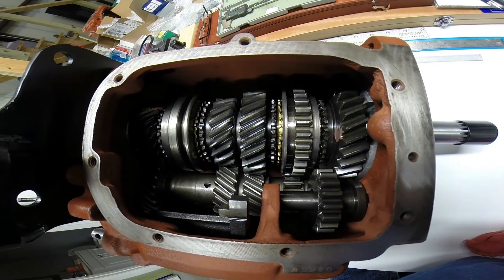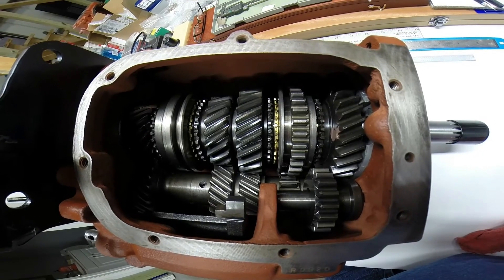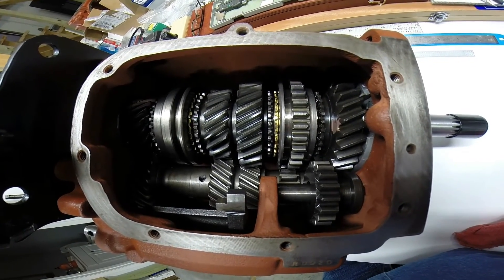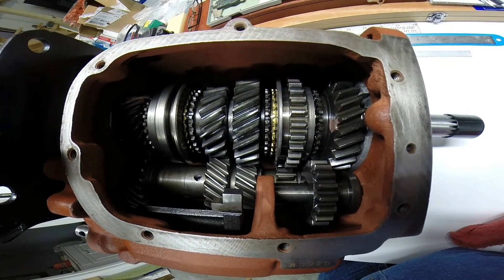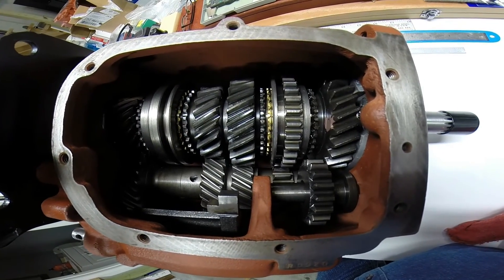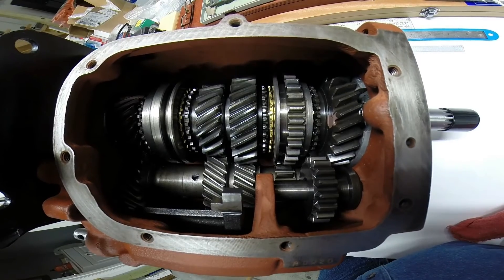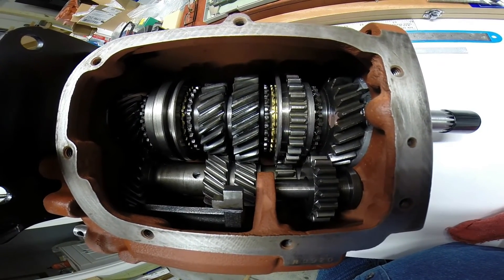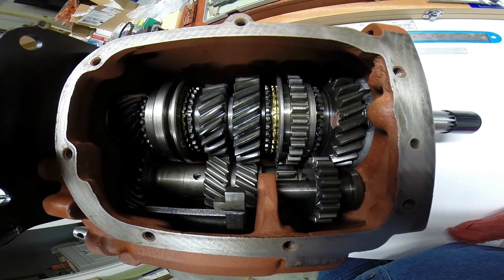This is looking inside a Corvair 3.11 first gear, first generation gearbox — commonplace for your stock Corvair. With either configuration you can use the regular Saginaw main shaft, cut it down, re-spline it, and everything fits. All the gears are identical and they are all interchangeable as long as you use the same number of teeth in the proper location.